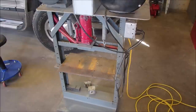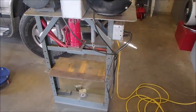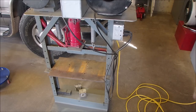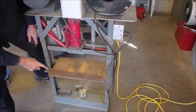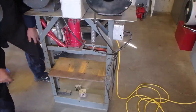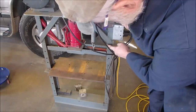Let's take you over there. This contraption is my homemade jack press — I made it out of an old, ancient, really heavy metal equipment rack for communications. There's the jack and the springs for returning. These bars can be adjusted to any one of these holes, so you can put something pretty big in there. The jack is big enough — way back in the day I bent it and had to put on a new top and some bracing bars.